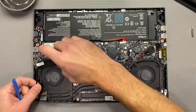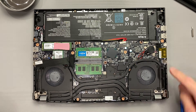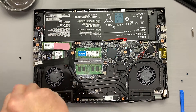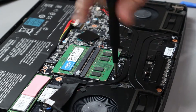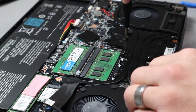You do not need to remove the cable entirely. There are two screws per fan that need to be removed as they will come attached to the cooler. One of the screws has another tamper-evident sticker. Next, back out the seven screws securing the cooler to the motherboard. One came out completely, which means the plastic clip did not hold the screw in place.